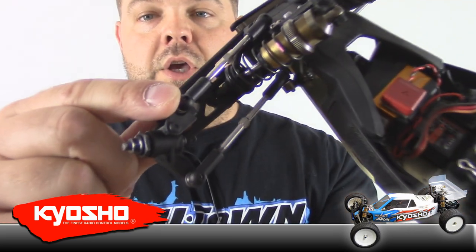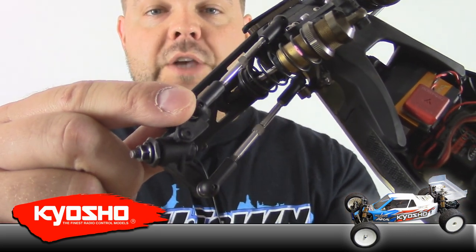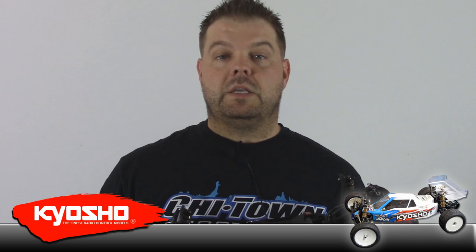The other thing I really like about the Lunsford Super Duty turnbuckles specifically is that there's a hole in them so you can put your hex driver in there and change your ball stud washers without popping off a ball cup. Every time you pop the ball cup off you're wearing it out a little bit, and it's more likely to come off in a race — which is the last thing you want.